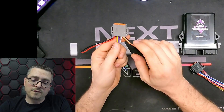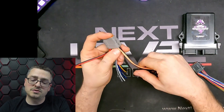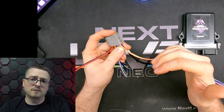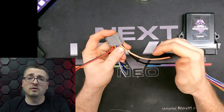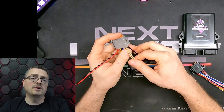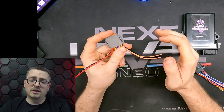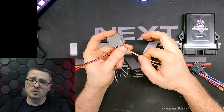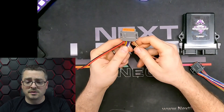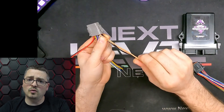For the gray plug, your first four wires are your power supply units — those are your 5-volt inverters that are built in, keeping in mind that those are 4-amp inverters. There are two of them, so a total of 8 amps across both. So there will be a little bit of a limitation to how much you can actually power with that. Just keep that in mind when deciding whether or not you're going to go with these or use an external power source. And these are only 5-volt — they're not suitable for 12-volt.